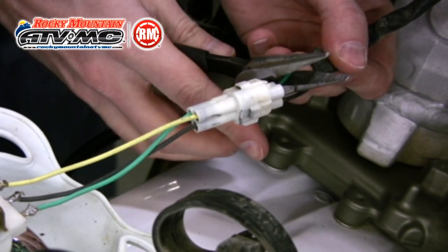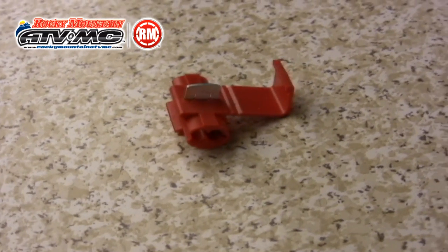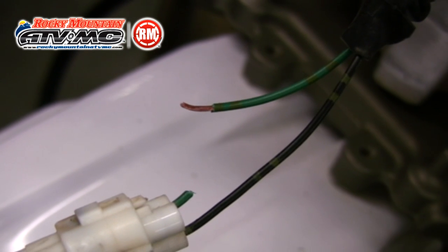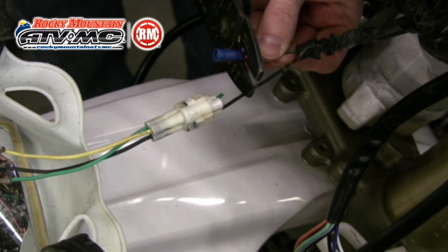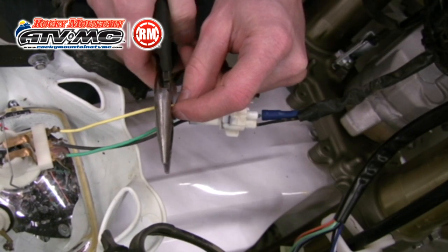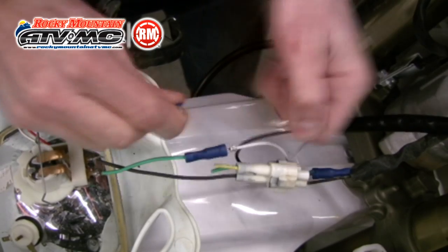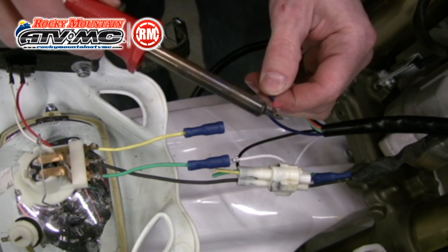Now we can start tying in the switch by cutting the power wire from the motorcycle. We're going to tie this power wire into the black wire on the switch by using a quick connect splicer or a female connector that can be crimped on or soldered on — in our case we're going to solder it on. Now I'm stripping the insulation off the power wire so I can install the connector. Once the wire is stripped I will put the connector in place and solder it to the wire. If you choose not to use solder you can use a connector that will crimp to the wires — these connectors can be found at any hardware or automotive store. Now I am cutting the high and low beam wires running to the headlight. Once the wires are stripped I will install the connectors. Make sure none of the metal from the connectors is exposed because you don't want them grounding out on the motorcycle and damaging anything. If your female connectors don't completely cover the metal connection, use heat shrink tubing or tape to insulate the connection.